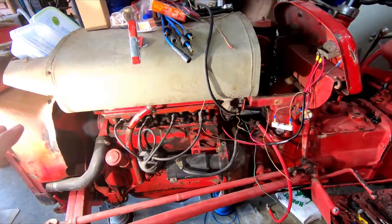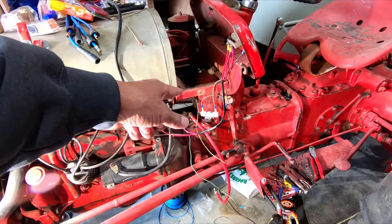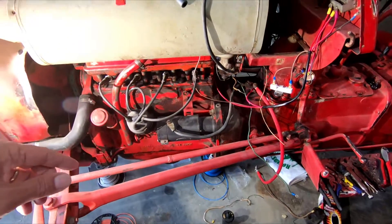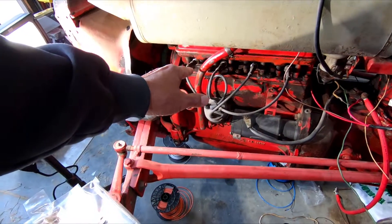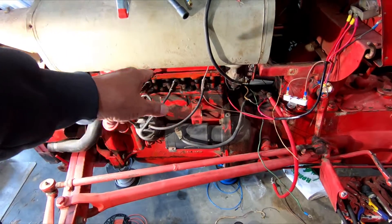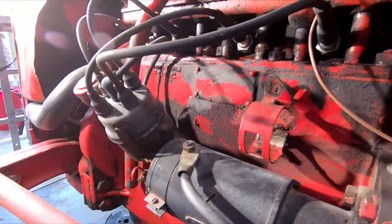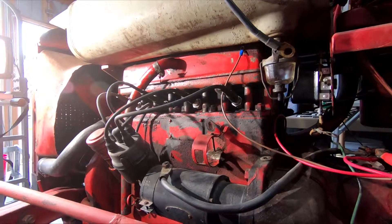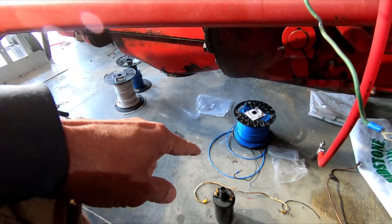My thinking is no matter what sequence you purchase these parts, you would end up removing that. If you only bought the coil, you would remove it because that's what the coil says to do. If you did not have the coil and only had the electronic ignition, you would leave it on. But any situation where you have the coil — the coil is before the distributor — so the rules for the coil are the ones you would use.